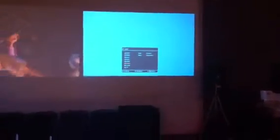Then we go down to the Blu-ray 1 and Blu-ray 2, taking the component video output and assigning their own channels. Now we spoke about this briefly where we took the HDMI audio only out of them and we're sending the HDMI video separately. But we also are taking advantage of their component outputs. So Blu-ray 1, the component has its own channel, and Blu-ray 2, the component also has its own channel.